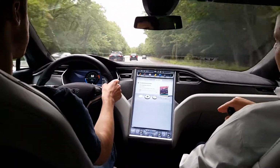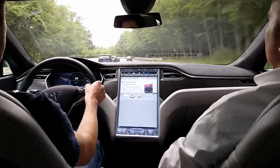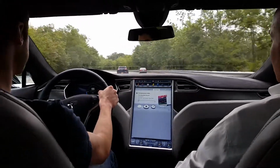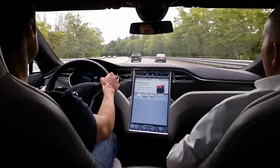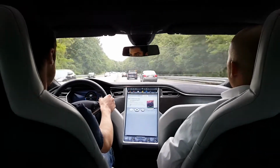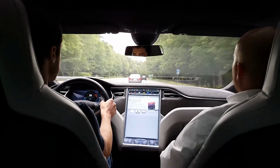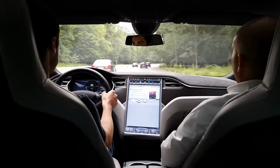You can set the regen braking to low, and that'll let the car coast like a normal car would. But I always tell people, just leave the regen braking on. When you're driving around town, you'll rarely even have to touch the brake. On the highway doing 65-70, the momentum of the car carries it further, so it won't brake so aggressively. Although, if you let off the accelerator at 65-70, the brake lights will actually go on because the regen braking is fairly aggressive.